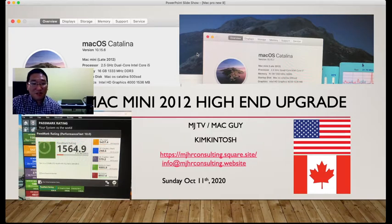For a high-end upgrade, you can upgrade the RAM up to 16GB DDR3 — keep in mind you cannot do more than that. Also, using a data doubler, you can have two SATA SSDs, or with an M.2 connector, you can use NVMe, which is faster than anything else.